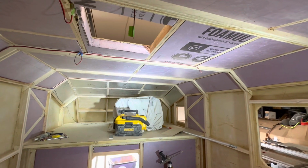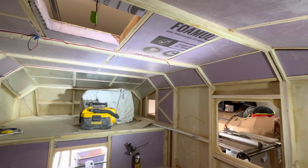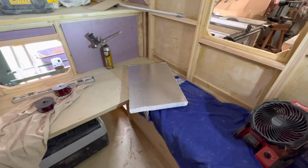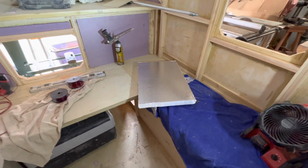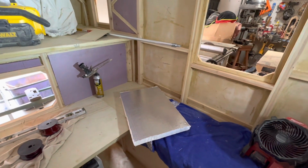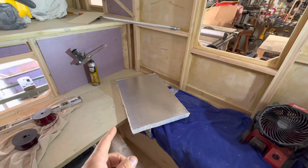And the rationale between the two types is, I think the XPS, since I'm forming it as a composite structure with the roof, adds to the strength. The EPS doesn't quite have that strength potential, but I actually really like EPS. I can't really describe it, but I just like the performance of the insulation. I also like the fact that it has this reflective portion there. Most of these cosmetic surfaces on the interior will be wrapped in fabric, which is something I've done on pretty much all of my campers, except for, I think, the very first one.